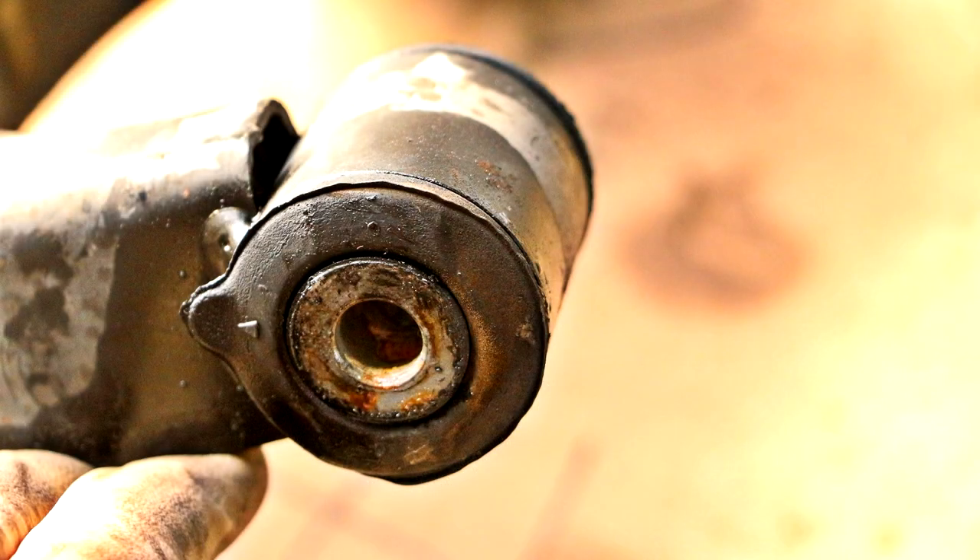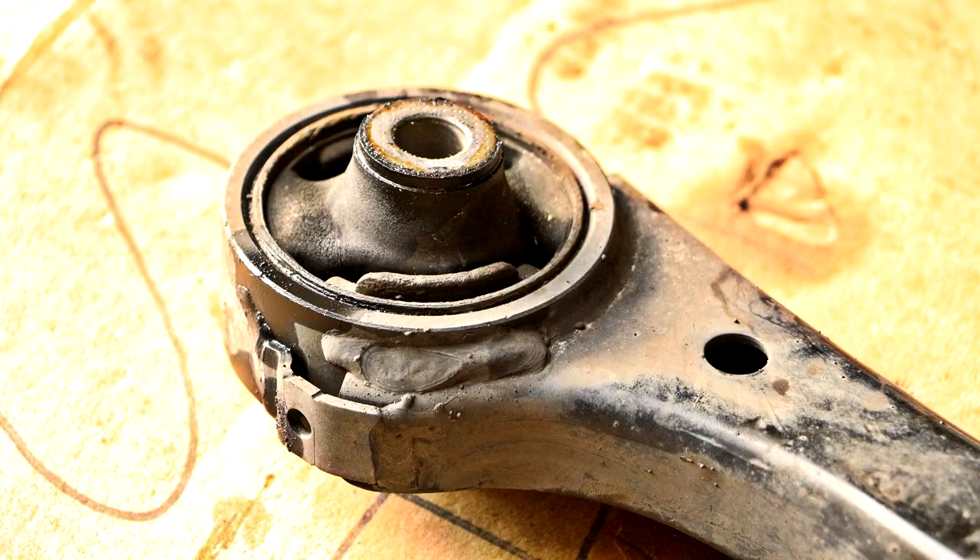Hello everyone — I'm back in the Civic driving it around. It's been a few days since I finished the install of the Energy Suspension bushings. I want to clarify that the only ones I actually ended up installing are the front control arm bushings as well as the polyurethane sway bar bushings. As you saw in the video, after taking apart the rear suspension, all the bushings back there are actually solid rubber with metal joints in between them, so they really don't fatigue as much as those front control arm bushings with their big voided soft rubber component. At the time being, I did not replace those. The new front bushings are a solid polyurethane bushing with a big metal sleeve in the middle — compared to that stock soft voided rubber bushing, there's less deflection front to back and side to side.